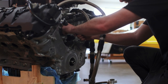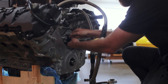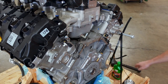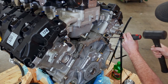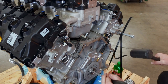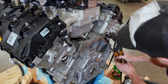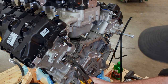Because of the unorthodox cooling system in the Model A — with the radiator at the back of the truck — we don't use a standard Coyote water pump. In its place we've got a water plate, similar to what we use on the K24 in the Ferrari, paired with an electric Davies Craig water pump, which has done a great job keeping the Model A cool. Coyotes are known for running hot at the rear cylinders, but if we hammer out the freeze plugs we can use a crossover system to allow coolant to flow head to head. Previously I never saw coolant temps get above about 180°F / 82°C.